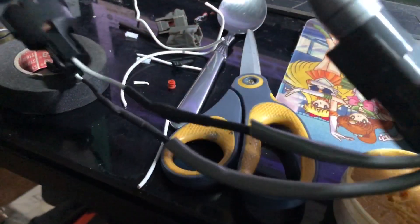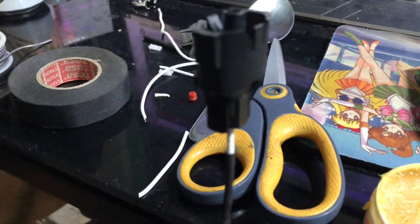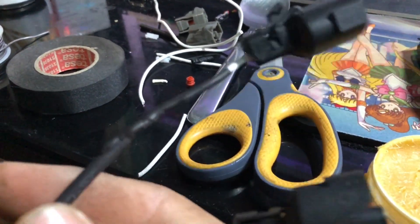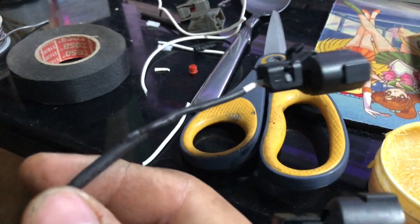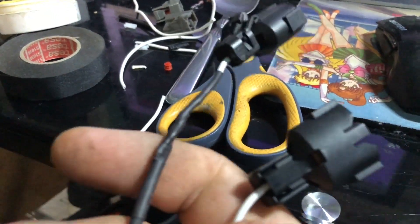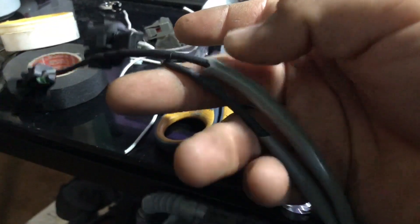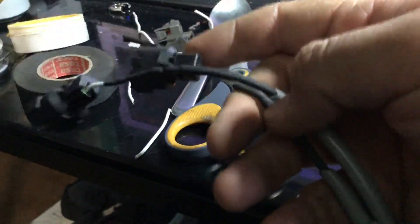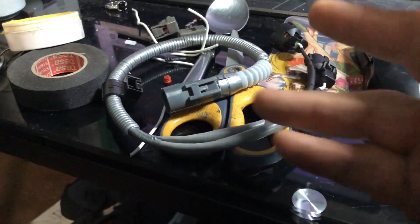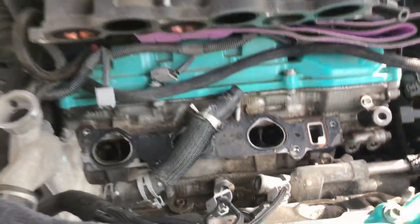I'm gonna take a break because I'm still a little iffy with COVID right now — I can barely breathe well and I'm wheezing. But for now I'm going to swap over the harness and solder on the connections. I was originally trying to de-pin the old connection and see if I could put it on the GM plug, but obviously that's completely different. So I had to cut the wire from the Toyota knock sensor plug and I pretty much just soldered it together — got my flux and solder right here. Used some heat shrink tubing and I'm gonna wrap the whole thing up with some electrical tape to keep it from cracking over time.